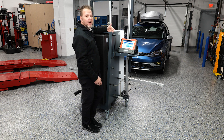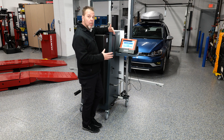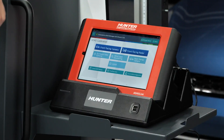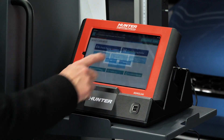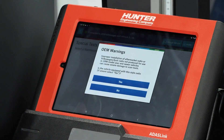This vehicle is equipped with a front facing camera, but nothing was done with the windshield — it was intact, not serviced, moved, or repositioned — so we don't have to worry about that one. We do know that the front facing radar was removed from the vehicle and reinstalled, which triggers us to need a verification calibration. So I'm going to select front facing radar. The scan tool is looking for the available test, and there it shows up as the ACC sensor adjustment, which is the one we're going to perform right now. There's also a warning that an incorrect radio could damage the scan tool — this vehicle has the factory radio, so we select no.